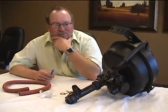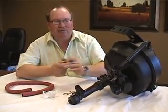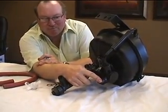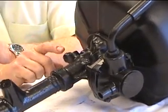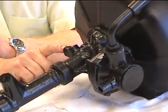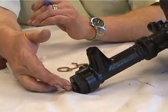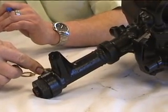What should we do when we install it? How should we do that? Well, you've got four different lines. You've got a breather line, your main supply line of vacuum from your engine, an input line on the slave cylinder from your master cylinder, and an output line to your wheel cylinders or the foundation brakes of your truck. And then a bleeder screw, of course, to bleed the unit.